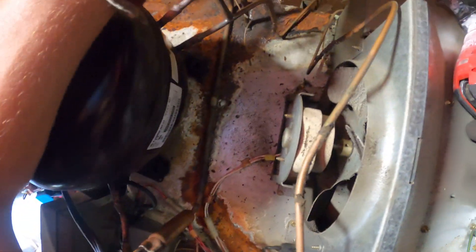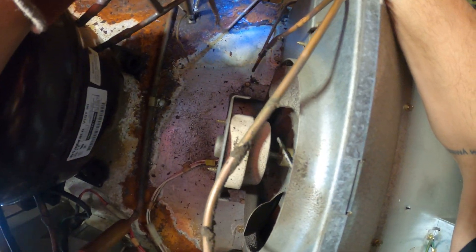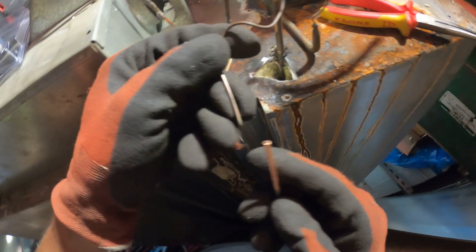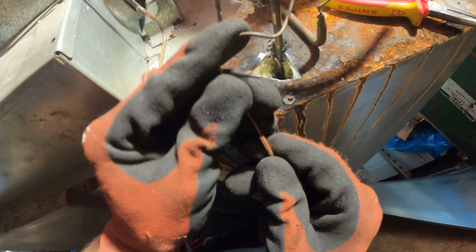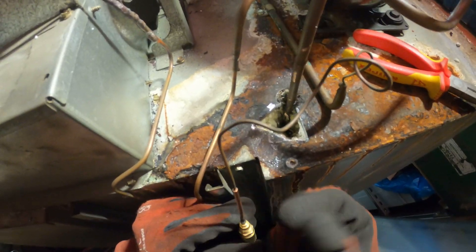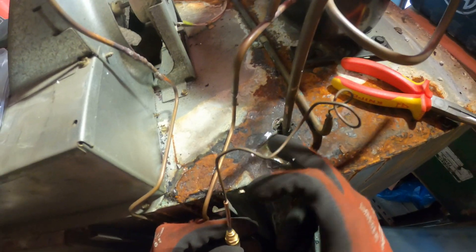I'm going to take this whole thing apart. Cut it open, took the foam out — this is the broken pipe right here. There are no couplings for this. I'm thinking I can use part of this pigtail as a coupling, and this is the cap tube cutter. This side needs to be cut a little bit for more access. This is my last chance with this one. As far as brazing this side, it's definitely possible — this almost fits right into it. If I can get more access and open up the ends, I could braze it right here. I really hope the last technician didn't just break this.